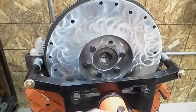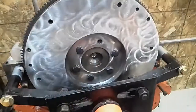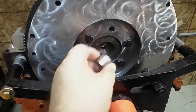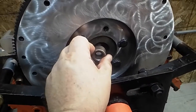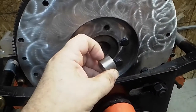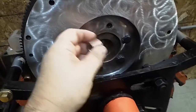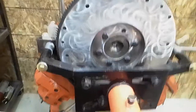The old way was to take the whole motor apart, precision machine a hole in there, and put a Chevy bushing into it — but it only sticks halfway in because you can't go deep enough. You wind up machining so that only half of it sticks in and half is unsupported in a precision machined hole. That's a terrible idea.